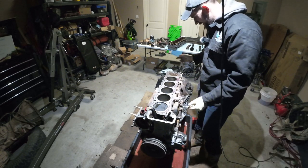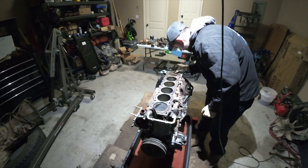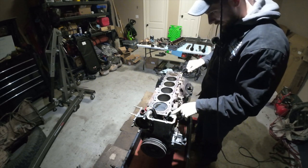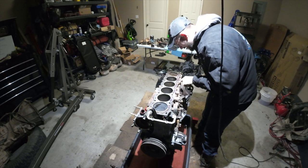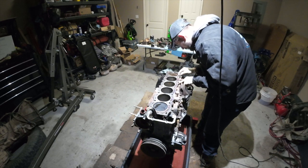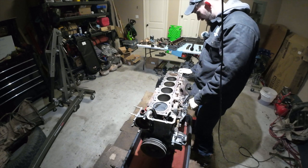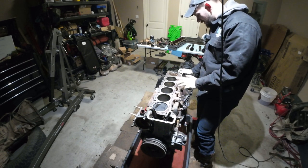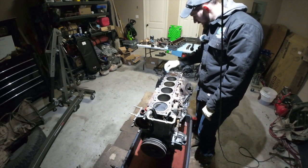Alas, here it is. So you can definitely see that, I don't know, man, something tells me that this head gasket was replaced before and potentially wasn't done well. Either it's a really cheap head gasket or it wasn't done very well, which both are pretty possible. I'm trying to see which failed. Kind of looks like a bunch of them failed, if I'm being honest. Primarily cylinder six. It's definitely cylinder six that was the failure point because that piston is very clean.